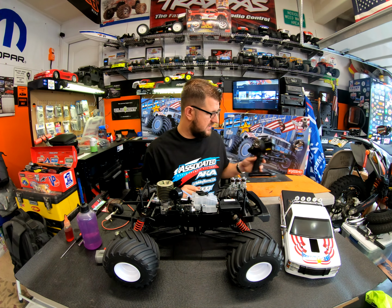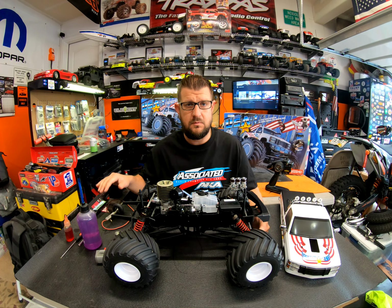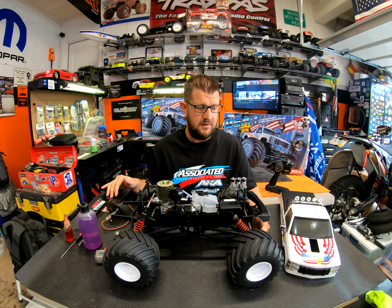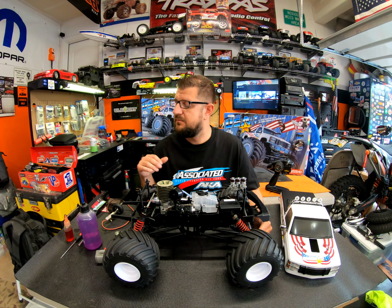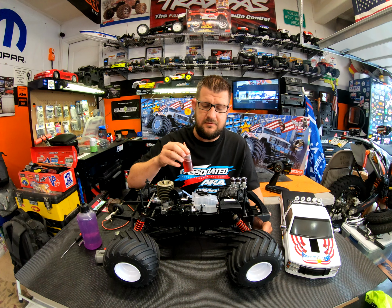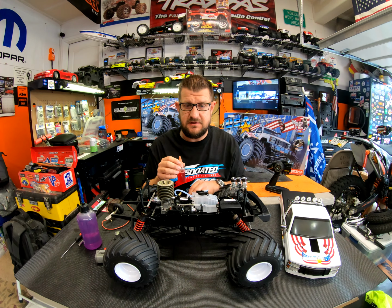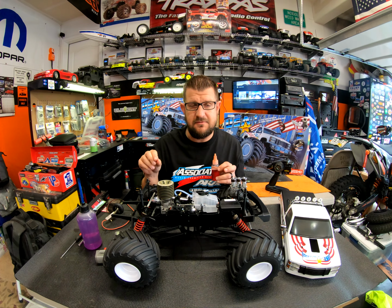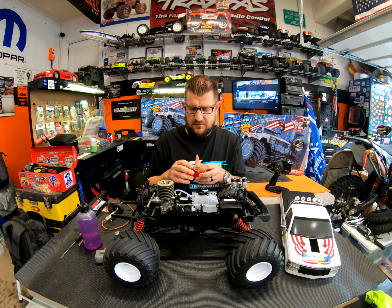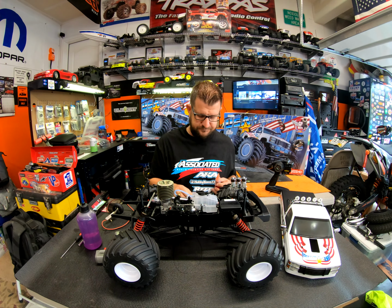Next thing, I want to cover just a few items that you should have right at your disposal when you start the break-in process. You shouldn't even think about putting fuel in the tank before you have these things ready to go. First thing is going to be after-run oil. You actually want to put some after-run oil in it first things first. Before you ever even think about pulling that pull start, you want to go ahead and drop about 5 to 7 drops of oil down the carburetor.